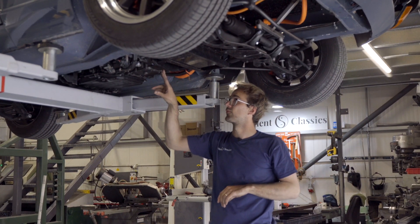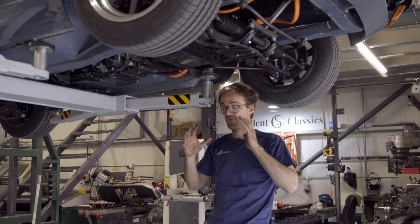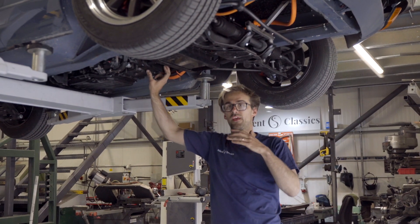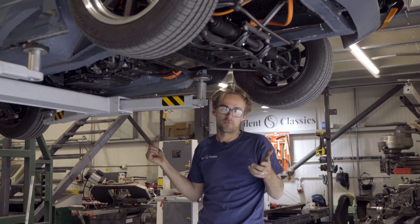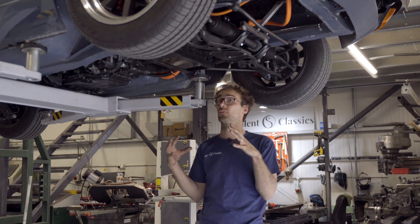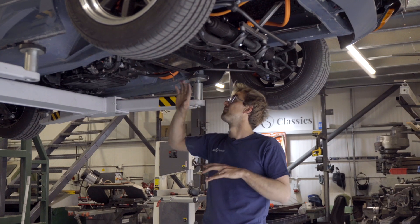The motor itself has got two electric motors built into it. In the original car, one was designed as a starter motor slash generator for the hybrid battery pack. But that motor now obviously doesn't need to do any starter motoring or much generating, so we're using it for traction power. Combining those two motors gives this thing a lot of punch to the rear wheel.